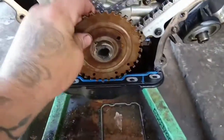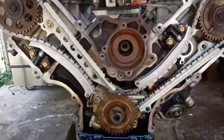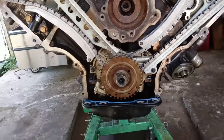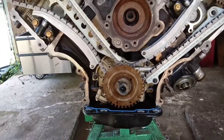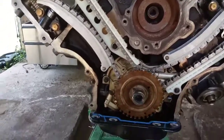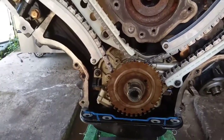I've had people that put them on wrong and contact me saying their engine's running but running really bad. I'll ask them, 'Did you put the tone ring on right?' They'll always say, 'Well, yeah, of course I did,' but nine times out of ten when we break the engine back down, or when they do it themselves, they'll say, 'You know what, Melvin, you were absolutely right — that tone ring was facing backwards. I didn't realize there was a front and a back.'